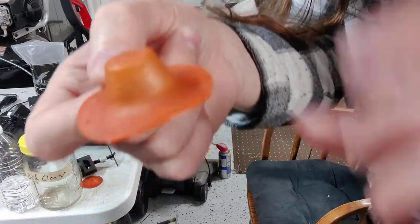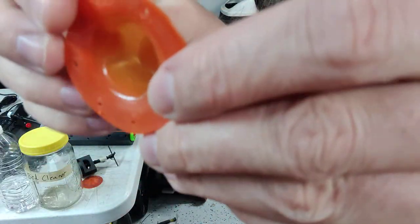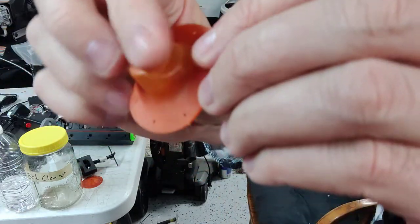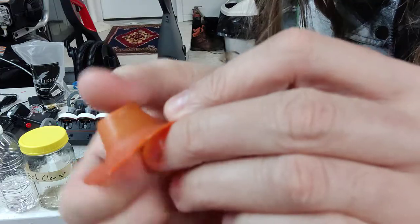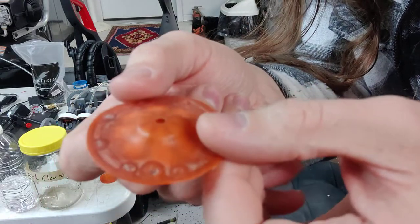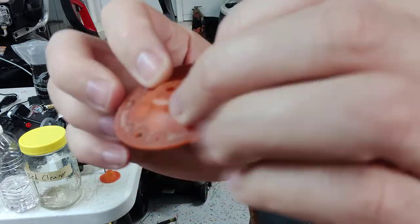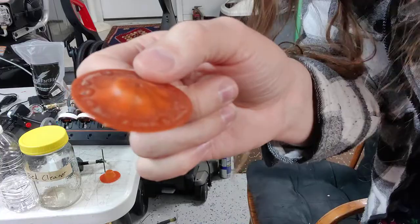Call it the sombrero. Now, you notice it doesn't have a hole in it, because I don't think this will work — it collapses down on itself. But that has a tremendous stroke, because what determines your stroke is the amount that your diaphragm is able to stretch. What I've been able to get consistently is something like this, maybe a little bit more — which equals out to be about a 25mm stroke. So this is what I've been using.